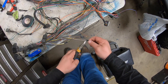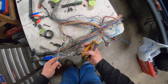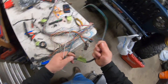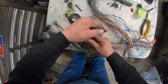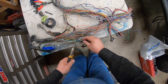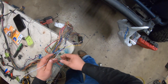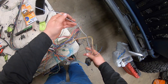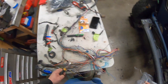There's another ground right down here — cut them off right there. Let's cut that out — your alternator plug is gone. The alternator for the Jeep is regulated through the computer, but with the LS swap I do not have to worry about that. This wire here goes back out to the main plug — it's probably like an exciter wire, just 12-volt power to there to excite the coil in the field.